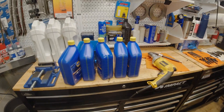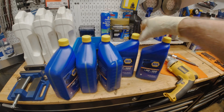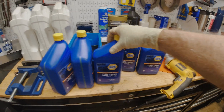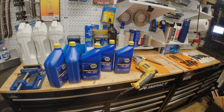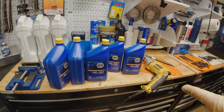Now, oil. You might want to just use a really cheap oil because you can empty it when you're done, or use your break-in oil. That's what I'm going to do. This is just 30-weight non-detergent oil, and this will be the oil that is used in the dyno.